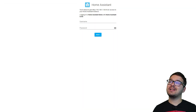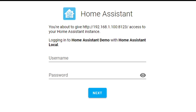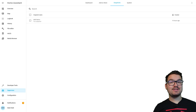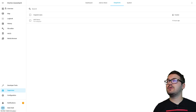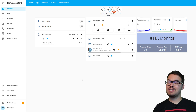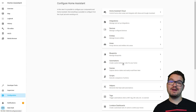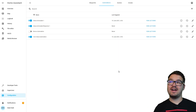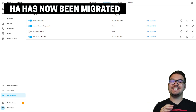We can see in the bottom left that it says connection lost and it's reconnecting. We now just need to give Home Assistant a few minutes to actually restore the snapshot, and once it does it will come back to life and should be our previous working version. I've left this for a few minutes and the browser has refreshed itself — it's now asking me to log in, so I'm going to log in with the account I previously used. It's taken me back to the snapshots page and I can see it has already worked because I can see HACS in the side. Pressing Overview at the top I can see all of the things I previously had on my old version, including integrations and automations — and they're now running. At this point we've managed to migrate our old Home Assistant across to the new setup, and it's now all contained in the Argon One.